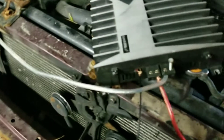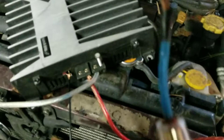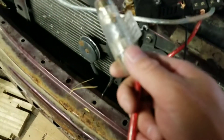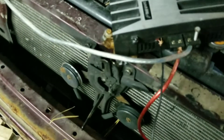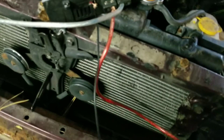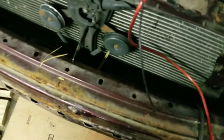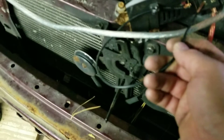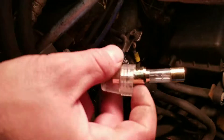What I'm going to do is stick my fuse holder with the fuse to the battery — that's going to complete a circuit. If the amp is bad it'll blow this fuse almost instantly. I might have to jump the remote wire, but actually I'm just going to do that first.